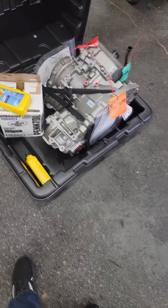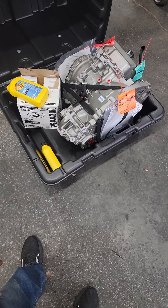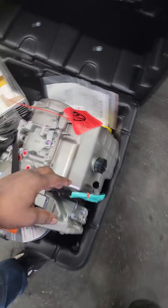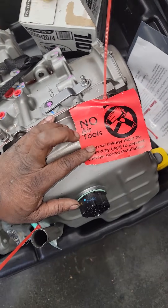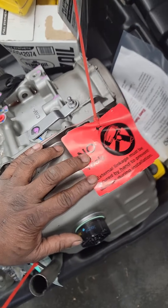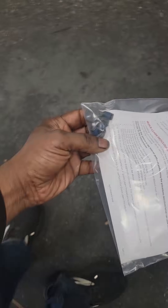Let me get the rest of it out. I need to find a transmission jack, and then we drop it and sling it out. I'm still tripping off this gasket — they had the nerve to put not one but two cork gaskets on a transmission that's supposed to have RTV, and put a tag up here saying 'No. 2.'